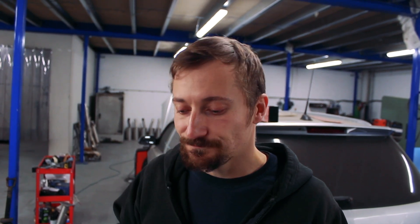17-inch wheels just aren't common on cars of that era and they look odd because you have to run lower-profile tires. I wanted small wheels over big brakes, which doesn't really happen. I had the option of changing the brakes but didn't really want to do that, and there are some elements of the rear suspension design you simply cannot change without massively restructuring the rear end.